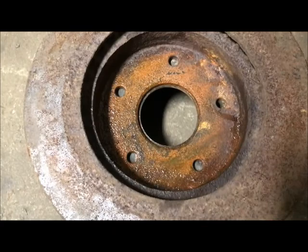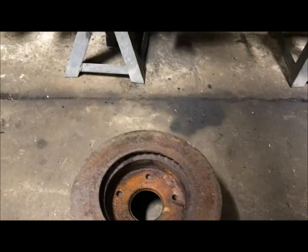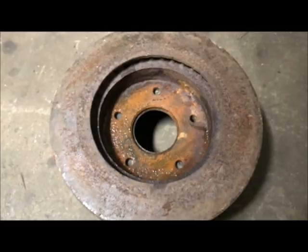And if it doesn't work, I'll just have to go get a drum. But based on what I see here, I should be able to knock the studs out of one of the axles from this rear and put the drum on it and make my own pattern on it and use transfer punches and pop holes in this factory four lug axle and turn it into a five. Is it gonna work? I don't know, but this is so crazy, I have to try it.